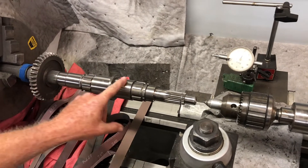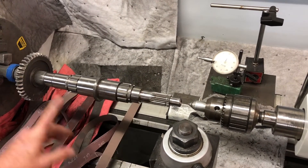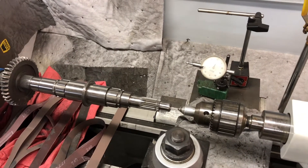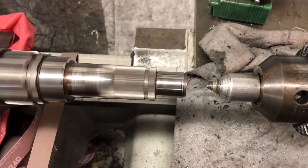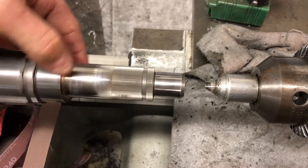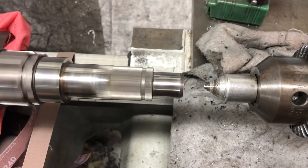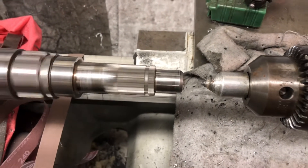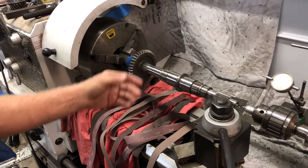We put this main shaft in the lathe to show you normally where they bend — especially if they've broken a gear. That was a fourth gear, and this is the end that fourth gear is associated with. As you come up the shaft it's first, second, third, fourth — fifth is straight through — and then sixth runs on a collar right here on the main shaft. This main shaft is bent from about this area onto the end. It's probably 30 thousandths or more run-out, and that is not acceptable. If you try to straighten these things, you might have luck — but normally when you straighten them they crack, and the only way to catch a crack would be to magna-flux it after you straighten it.